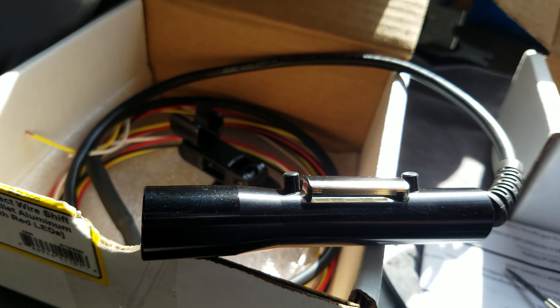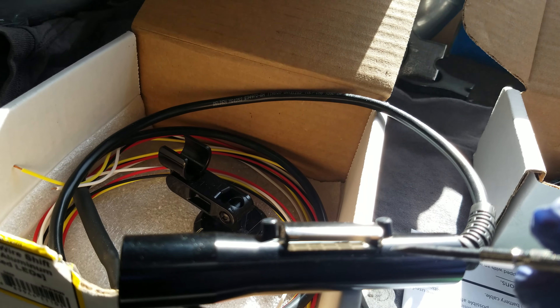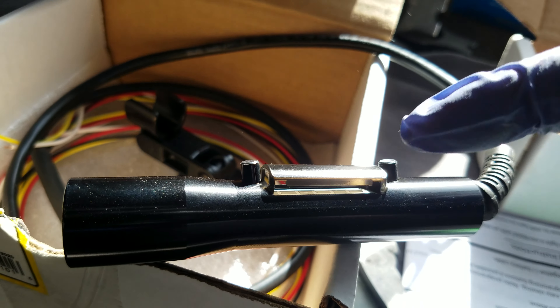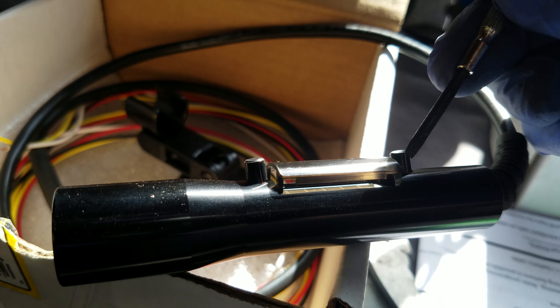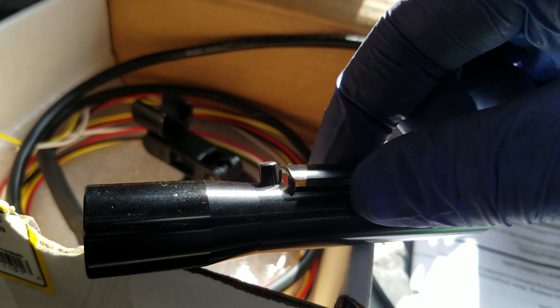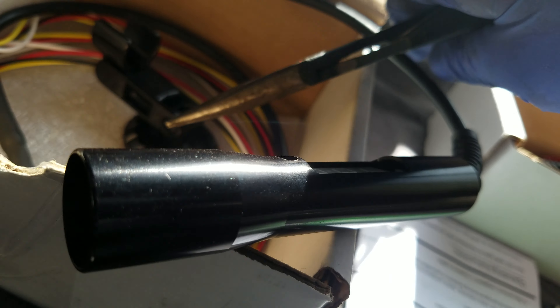I'm cheating a little with this part. I took a little flat head — you can kind of see there's a little opening on either side. This will be pushed down inside there, but you just kind of go in like this and just pry it a little bit, and it'll pop up and out of there. These guys are real simple — just use some needle nose. They just fit down onto a little square head inside on the circuit board, but they come off real easy.